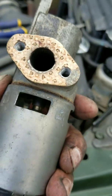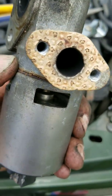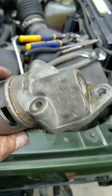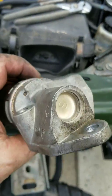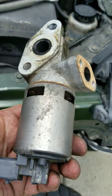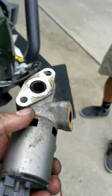The gaskets are a little brittle and powdery. The EGR was stuck open — that's what the dealer said, and that's the reason why it wasn't starting. I know it was kicking back an EGR code a little while ago, and then it cleared up, and I didn't see anything else about it. But hopefully this is the issue. I got a new one, so I'm getting ready to put that pig back in here.